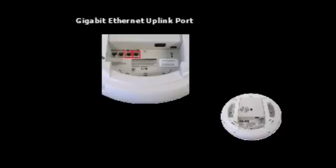The last two ports are the gigabit uplinks. These ports can be configured multiple ways, including link backup for redundancy, standard 802.3 AD link aggregation, port mirroring, and even as a standard bridging service, allowing the ability to daisy chain up to three arrays over a single data connection.